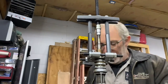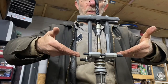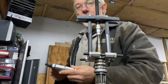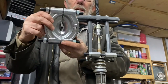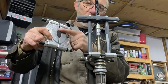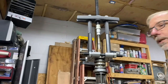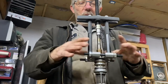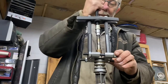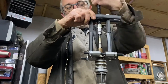Did a little re-rigging. I had to take the entire clamshell and flip it over. In case you don't know, one side is dished out and the other side is flat, so for me to be able to get under that bushing I had to flip the whole clamshell around. The nice thing is this is a lot looser now — I can dang near see it coming. It's a snug fit but I don't even know if I would even need the puller now, it's coming right off.